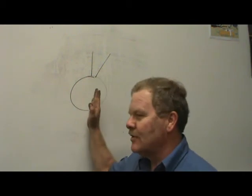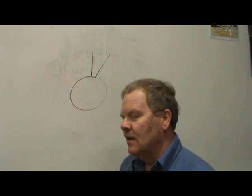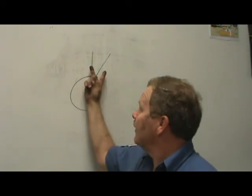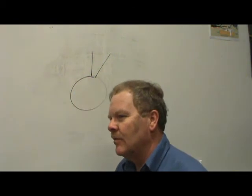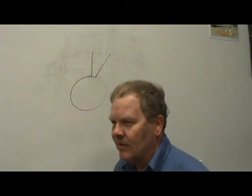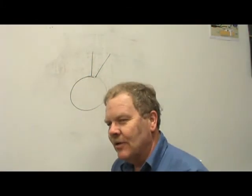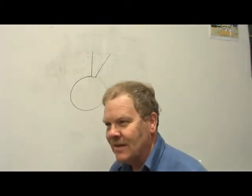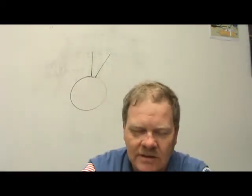But they originally were designed to use, and I had one in my toolbox for years and years. I don't know where it is now. But anyway, about 30 degrees is usually what a V8 dwell would be on. It would vary just a little bit between a Ford and a Chevrolet and a Dodge. You could also set the points with a feeler gauge, 17 thousandths of an inch or something like that. So, all right, now let's look at number 6.